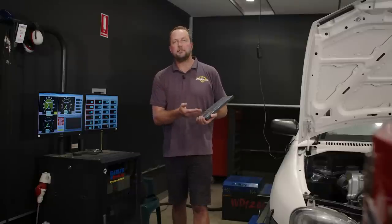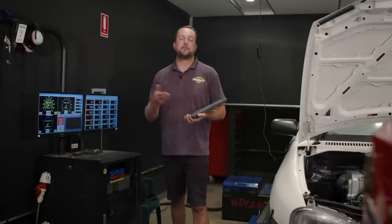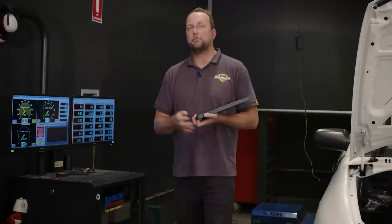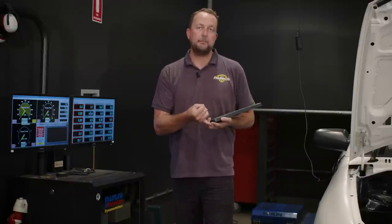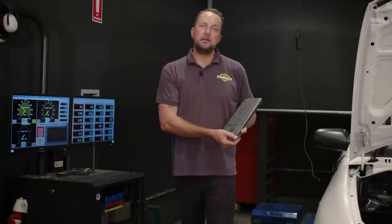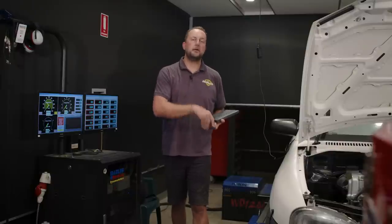What we need to do is first figure out how much vacuum this thing is going to pull and decide whether we're going to tune the thing still based on manifold pressure or whether we're going to convert all those tables across to tune off throttle position. But here's the secret, still in the fuel map using VE, volumetric efficiency tuning. That means that we're still going to need a manifold pressure reference because the engine management system, even though we're still going to tune off throttle position in the fuel map, it still wants to see manifold pressure because we're going to use manifold pressure in that VE calculation to determine the density or the weight of the air going into the engine, in turn being able to mix that with a known quantity of fuel, giving us our air to fuel ratio. I'll show you what it looks like with manifold pressure, then I'll flick over to throttle position.